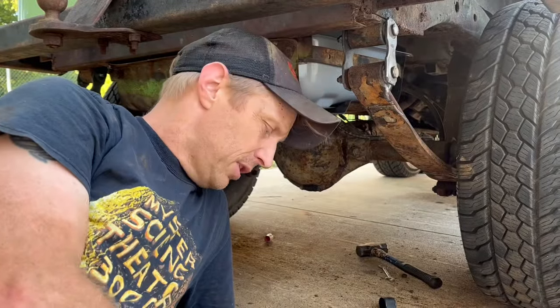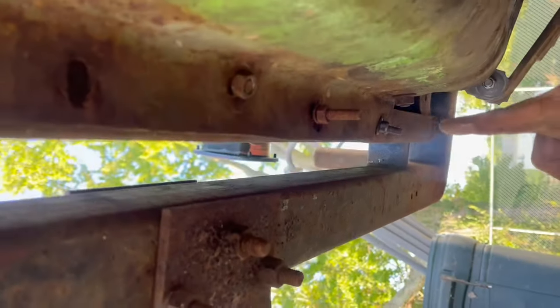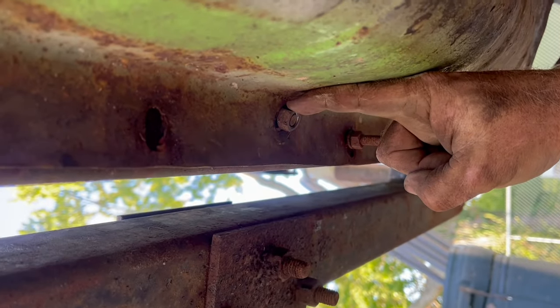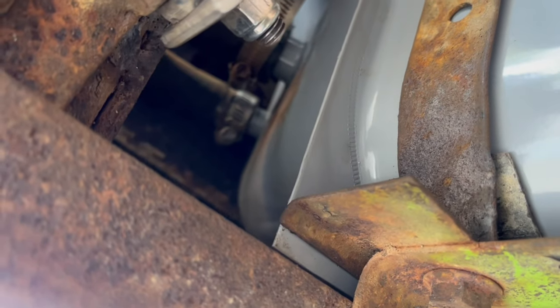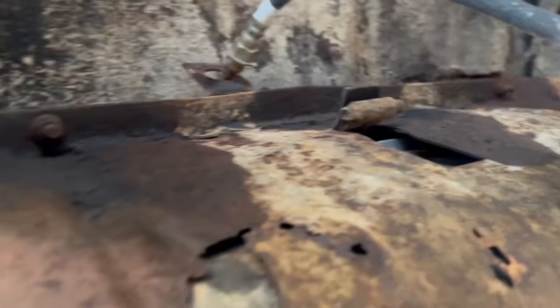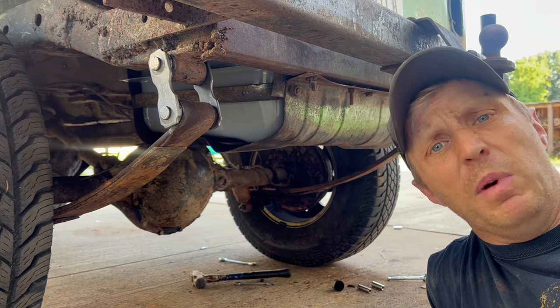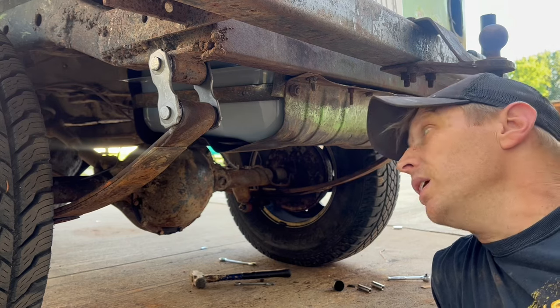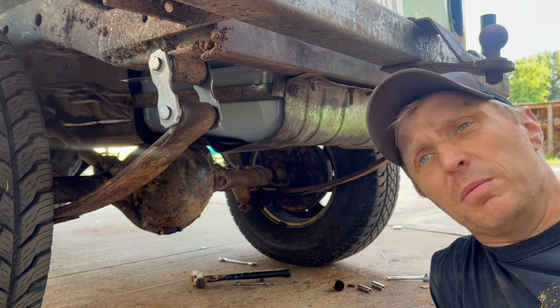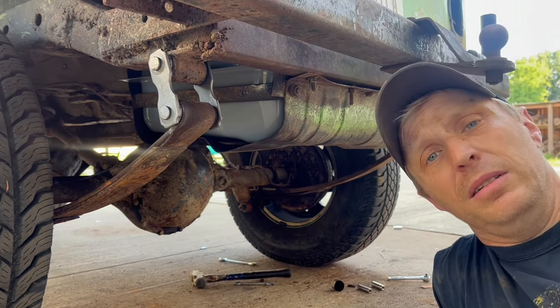It's been a couple hours, and after a couple long fights, a couple cuts, and the reuse of some hose but not all, we've got this gas tank back in. Here are the rear bolts right there. This is the tank strap on top that was missing from before, but now we have it. There are the two fill hoses with new clamps — both those hoses were still in pretty good shape but the clamps were shot. Up front here, never mind those rust holes — you can see the tank strap and the bolts that hold this thing in on the driver's side, new ground wire, fuel line, and I hooked the tank back up to the gauge. Now it's done. I've got a tank that doesn't leak because I haven't drilled a hole in it and tried to patch it with JB Weld like whoever did this last — unbelievable. Still a pretty cheap fix. I did find some rust I didn't want to see, but we'll worry about that later. I'm gonna put gas in this thing and see if it starts. Until then, we'll see you next time.